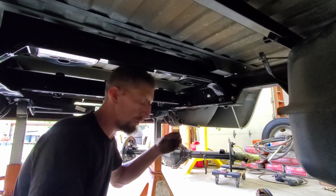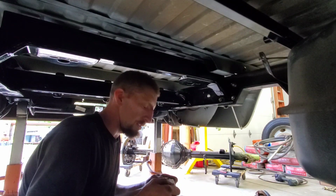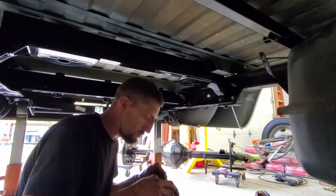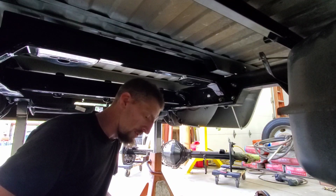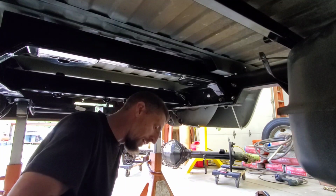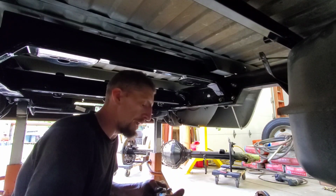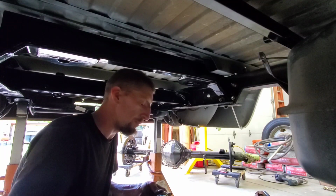Not that it's overly difficult with this cushion clamp here. I can always take it out. I Teflon'd everything, put everything in, so hopefully there's no leaks. But what I really got up to do was, because that cushion clamp doesn't hold it tight enough, this is where it's right, wrong, or indifferent. I am taking some electrical tape and I'm going to make a few wraps around the filter, which should still be able to unscrew from the manifold.